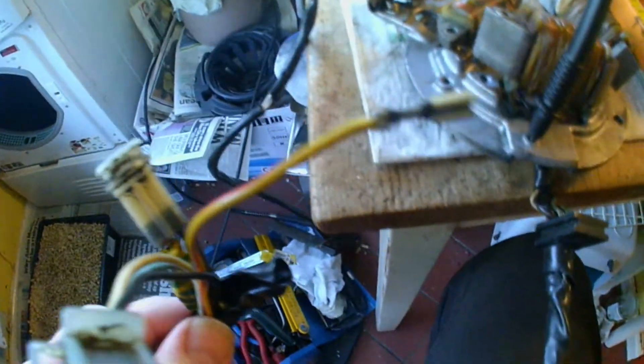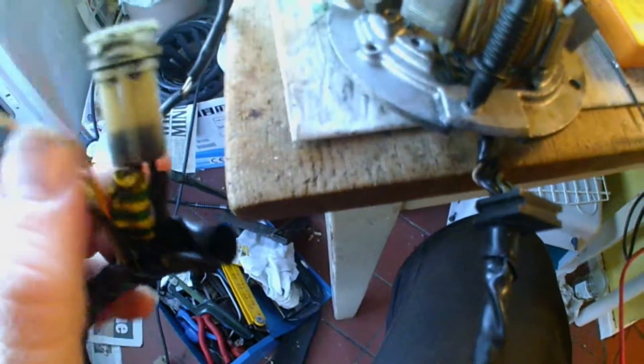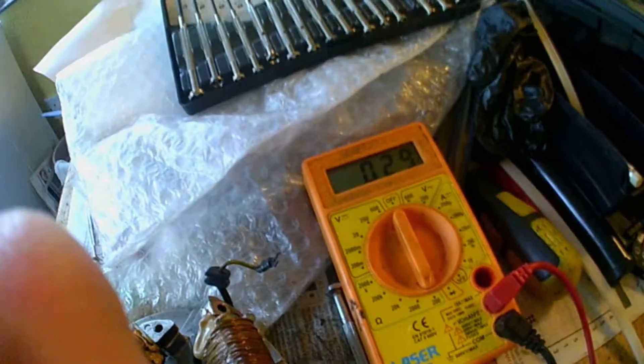This is the final video on the stator. I isolated this live wire — there's no two ways about it, it goes to the headlights to power them for example. Attaching a probe from the multimeter with another probe on the earth — it's got a definite short circuit. I'm going to get a new stator — what else can I do? If I want to take these apart and rewind them in some serious soldering iron shop — I mean what the hell is this stuff? How do you melt that? Let's just get one that's working.